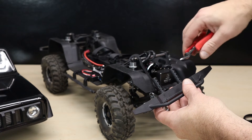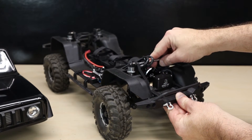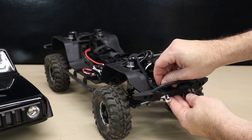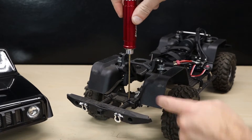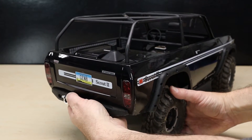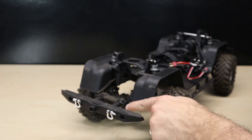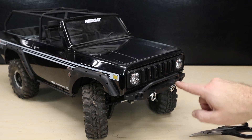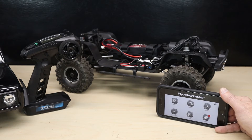Start by removing the two bumper screws, remove the bumper, and cut off the post beyond the last hole. Slide the bumper all the way back into the mount so you can see the two holes and reinstall your screws. Repeat the process for the rear — however you don't need to cut off the end of the post. Slide the bumper to the desired position, line up the nearest hole, and reinstall the screws. Once you've tucked the bumpers, you may need to trim the body for clearance.